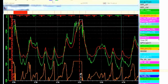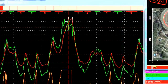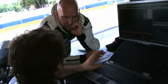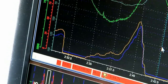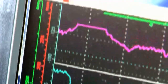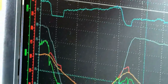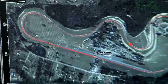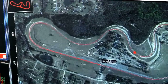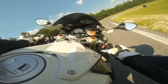I have four levels of engine braking, and I'd like to use maximum engine braking for third gear. Let's see where you're at at the moment. Since we have these four levels, I propose to go one step at a time — just third gear. Actually, on this track most of the corners are third gear where you're rolling in. I can also put that on slick mode. So we make the adjustment of the DTC on slick mode and the adjustment of the engine brake on slick mode, just for third gear. Let's go try it.